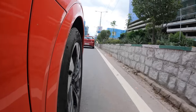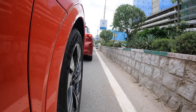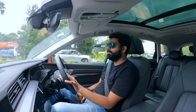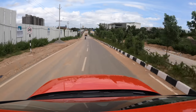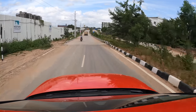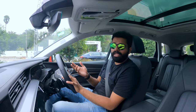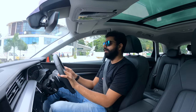I have the regeneration at the highest mode, so even if I leave the throttle for a second, it can come to a halt in a few meters. The braking feels much better than what I experienced in the Q8. In highest regen mode, the braking is pretty sharp. At higher speeds it feels like it comes a little late, but that's the pedal feel — it has brake assist too, so if you press it hard it will stop quickly. Nothing wrong with the braking power.